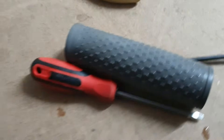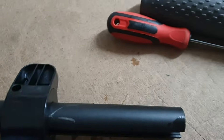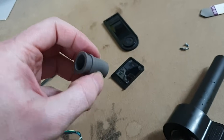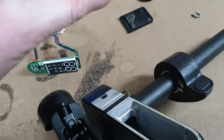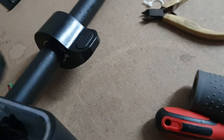To get it back together, slide the new throttle on, push the wire through, clip that over, and seat it back into the hole. Refit the LCD, push the wires through. Remember to put this back on — it basically just stops the water getting in and keeps those three wires together. Then a new cable tie, and these stick back on alright.